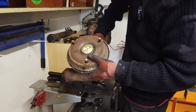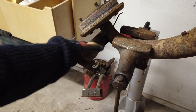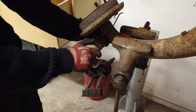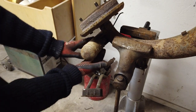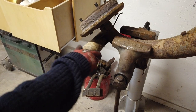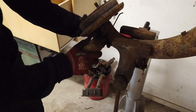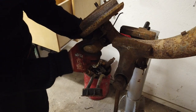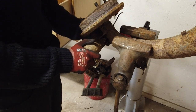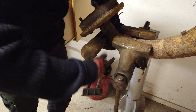Next I'm going to go ahead and tear down the swing arm. This part of the swing arm is actually a damping device — it avoids the swing arm or tire from starting to bounce. It's just a weight inside a tube with some oil in it, counterbalancing the movement. I'm not going to remove this though, because even though it's bolted on, I know from experience that it's very likely to snap. So I'm just going to leave it as-is and clean it up and paint it.